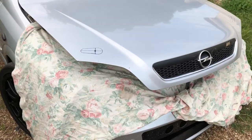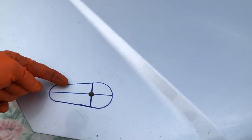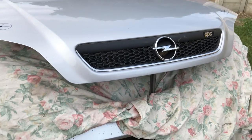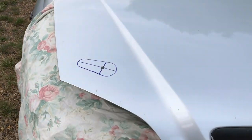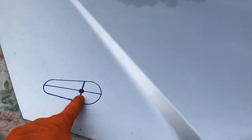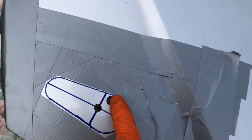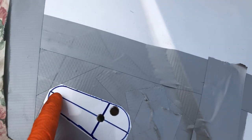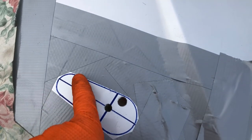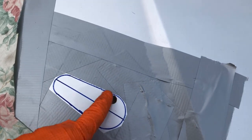The simplest way now is to drill a hole close to the line - you don't want to go past this line, you want to go inside it. You can always take material off but you can't put it back. I've put a tube there to raise the bonnet off so the jigsaw blade can cut around there freely without catching on anything. I've drilled out the hole right up to the line - that's going to allow me to get the blade in there and start cutting. On these radius bends I'll drill more holes around the bend so you can dot-to-dot and get the rounded circle without having to cut around with the blade.